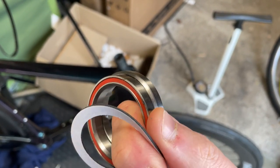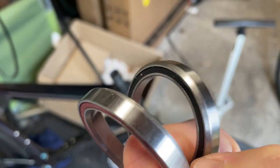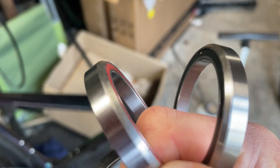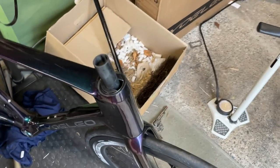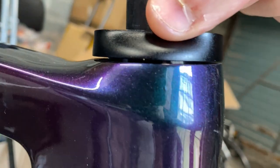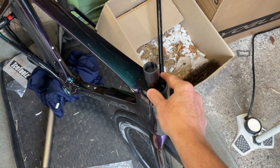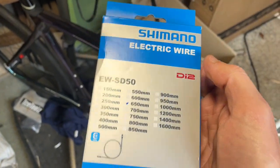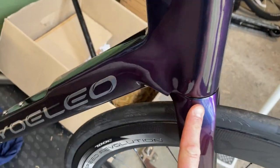What I've actually ended up doing is not using the 8mm bearing — I've used the 7mm which is the black one. When I put the top cap on, the 8mm bearing was just rubbing the frame when I tightened it down. So I've got the 7mm and I've bought a 1mm neoprene washer, which I've stuck onto the split compression ring — you can see that rubber bit on top. When I compress it down, the gap pretty much goes to nothing and it doesn't rub the frame. That is my solution for that. Also the 650mm wire has come, so now I can go right up to here and out of there. That's perfect.